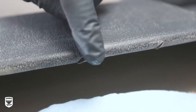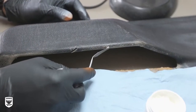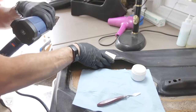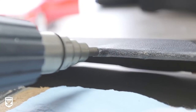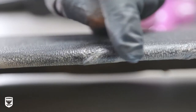The door pocket has a gash in it that requires a special repair procedure for vinyl. The paste is applied and heated up, then textured, then reapplied, heated up, textured, and so on until it fills the gap as desired. Much the same concept as Bondo in paint repair prior to repainting — however, for the record, this is not Bondo, so don't try that on your interior.